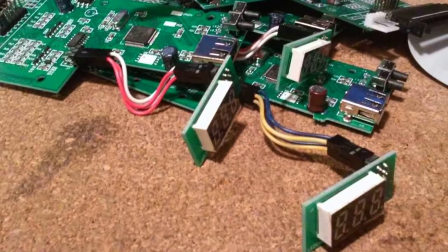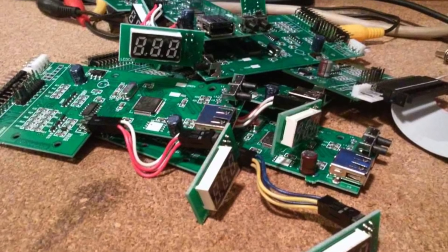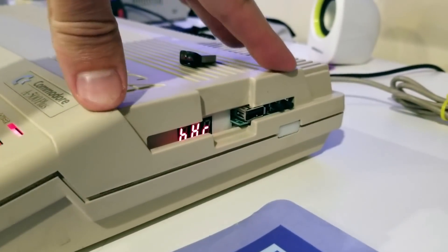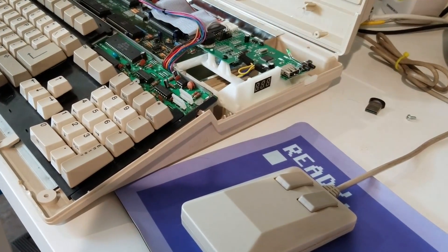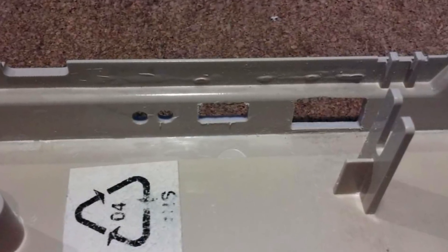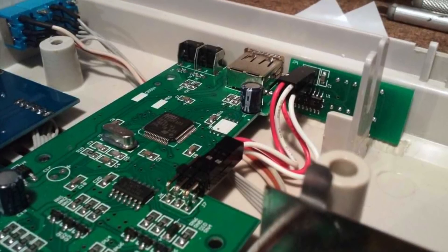So what better to go with a pile of Amiga 500s — well, a pile of Gotek drives, of course. In a recent video I installed a Gotek mount which let me put the Gotek drive inside the Amiga 500 in the floppy disk slot. That was pretty good, but I think it's time to go one better. Let's see if we can mount the Gotek just here under a real floppy disk drive. So let's start off by making some holes in the case. Usually I'm not a fan of doing this, but the end result I think is going to be worth it. We'll file down in between those holes to make a nice rectangle. And before long we can slot the Gotek drive in, and it fits neatly under the floppy disk drive.